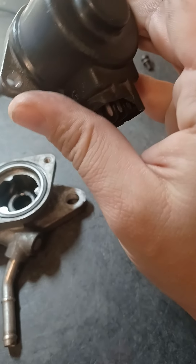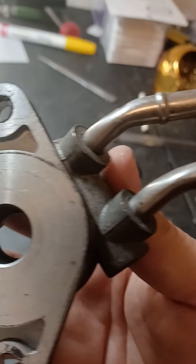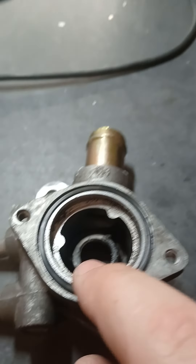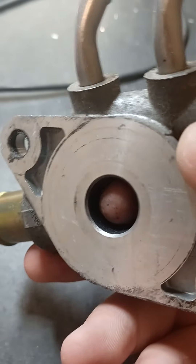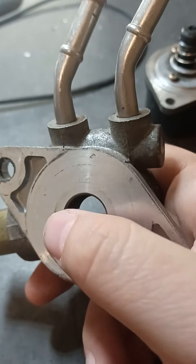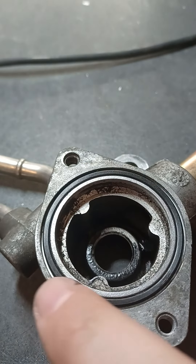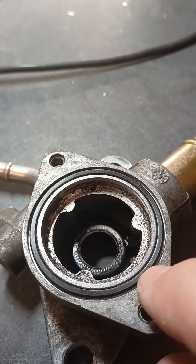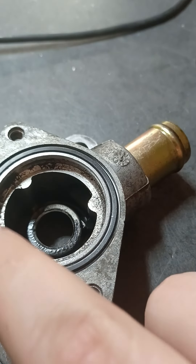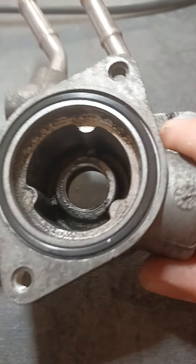Now that those are out, we're going to get this servo motor off. There's the plunger that articulates in and out of the hole. It's a very simplistic design — an O-ring seals up against here, and this would go into the intake manifold. There's a little tiny rubber flapper door diaphragm in the intake manifold that acts like a one-way check valve. You can replace this O-ring at any auto parts store — don't let the dealership tell you that you have to buy the whole unit.